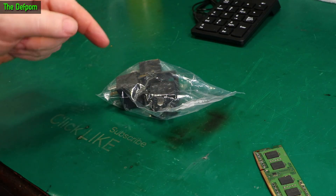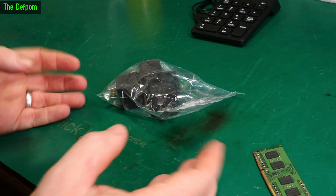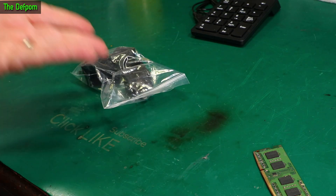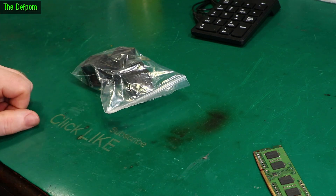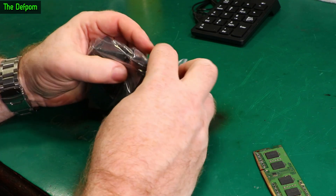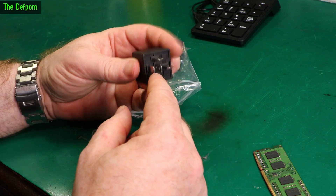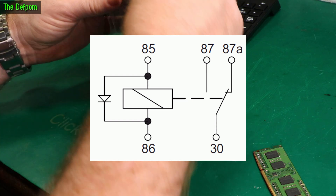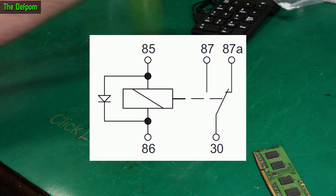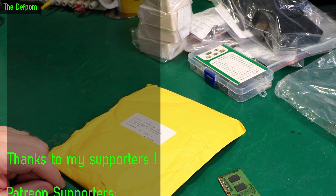How handy to keep on hand - 12 volts, you can use them for all sorts of things. You don't have to use them on a car; you can use them on a project. If you've got an enclosure, there's a mounting tab here, you can screw it to the side of the enclosure and have a 12 volt high current relay. One thing I always recommend: stick a diode across the coil to prevent back EMF - even in your car, do it in your car as well. This one came from Ireland, but it says made in China. Weird.